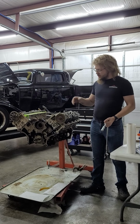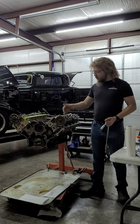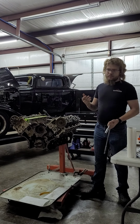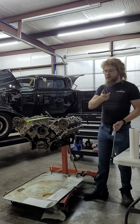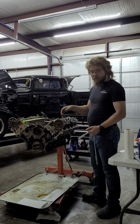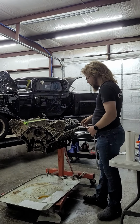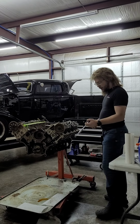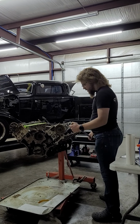Valves, valve springs, of course. But you can have your followers, not rockers, on it. And you can have, of course, your lash adjusters in. They're like your lifters on an overhead cam motor. You can even leave your cam on. You don't have to do anything up here. All you do is break it loose.